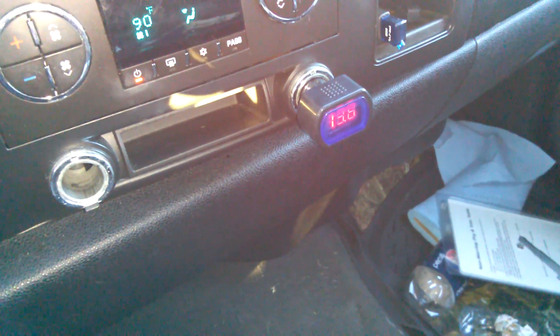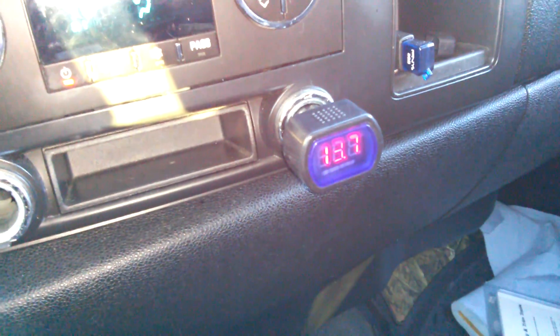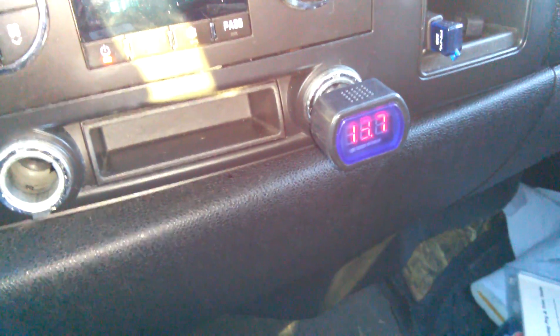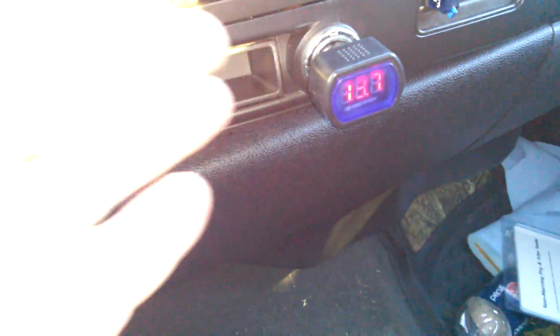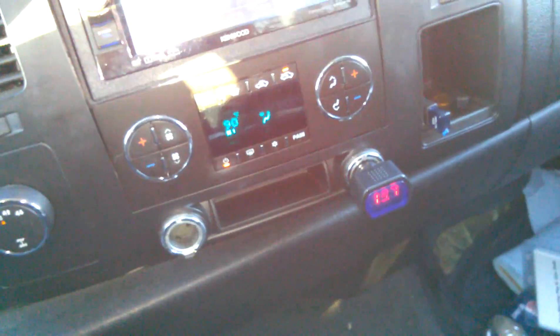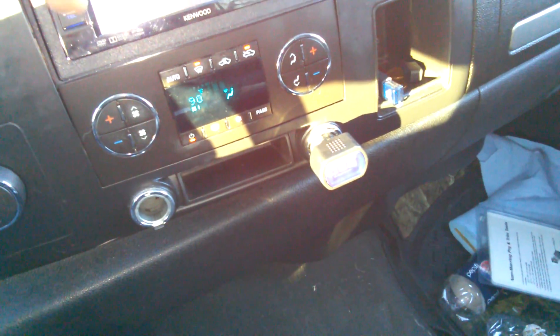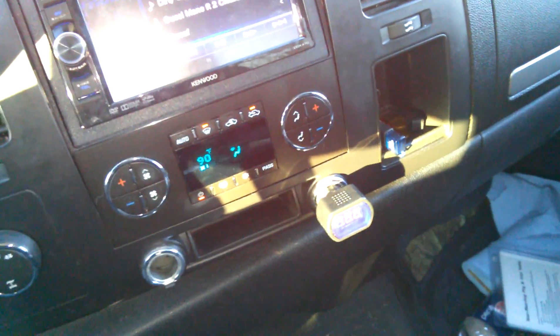They're rated at 12 volt — true 12 volt. One thing I didn't mention: got a couple of DD 25-15s — not 35-15s. But if I go plug that damn alternator in and cycle the truck again, it may sit at 13.7, it may drop — that's fine for everyday driving. If you need it to constantly recharge after you pound the shit out of it at a competition, unplug it. I haven't seen any videos on anybody that even knows where the grounding amperage clamp is on these trucks. I've looked it up on forums and every other thing. I'm going to meter the shit out of that thing and figure out what it is. I'm going to see what the CPU is looking for to get that to 14.9, and provide it — so I can plug that into the amperage clamp when I'm in competition.